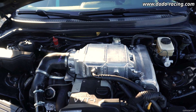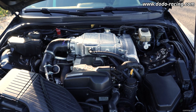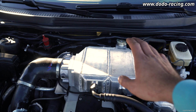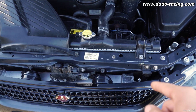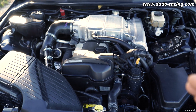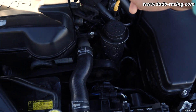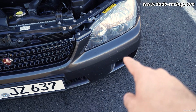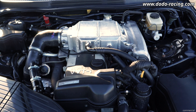Either you need to run an IACV or your throttle body needs to be in closed loop. Most people think water-to-air intercoolers are pretty complicated — I agree, if your car is already boosted and there's an air-to-air intercooler. But if you're coming from a stock naturally aspirated car, this is much easier. You just need to replace the Y pipe, run some hoses, install the pump and the radiator. The radiator is much thinner, you don't need to cut anything. The hoses are thin and flexible, you can route them wherever you want. You don't need to relocate your power steering, your washer fluids, or anything else. It's much, much easier.